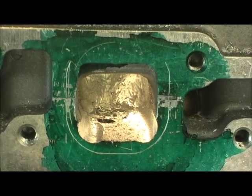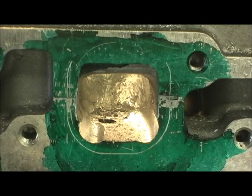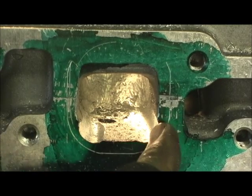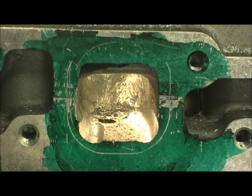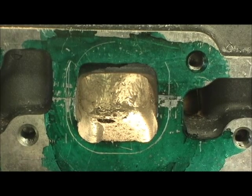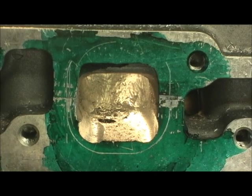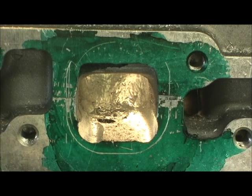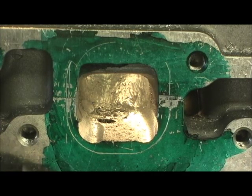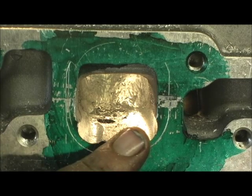We're on the exhaust now and I did chunk quite a bit of material out of here. I set my trenches, but I didn't go all the way to the curve. I want some reversion because it's got a cast iron manifold, but what I was looking for is a little bit of ski jump, a little bit of lift, so that the turn doesn't have to be so dramatic — not an L shape.